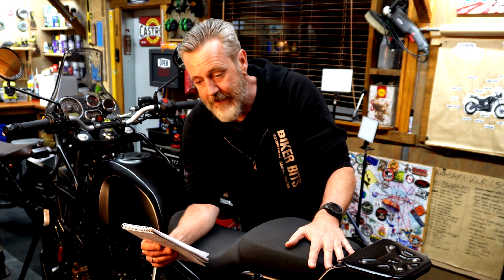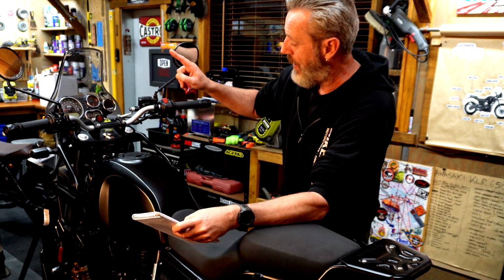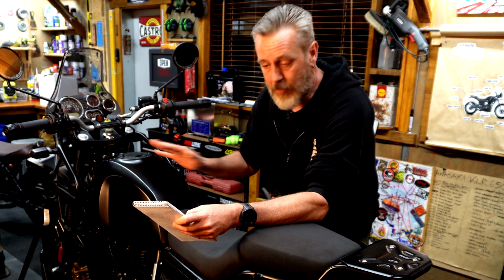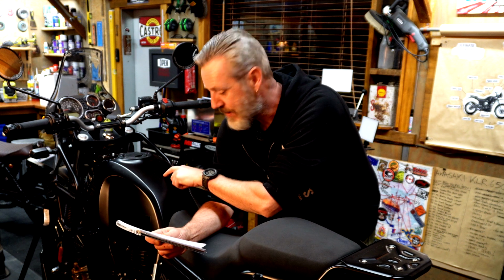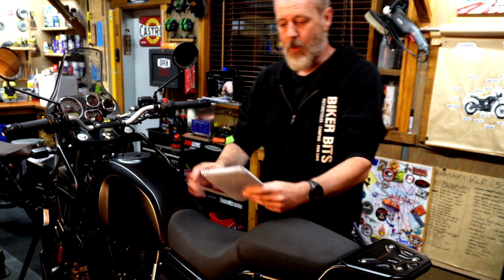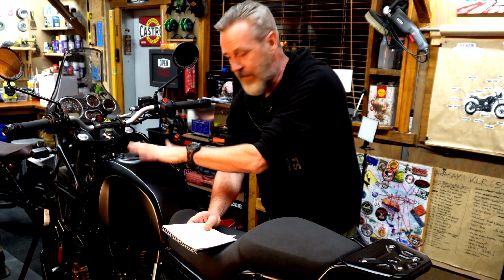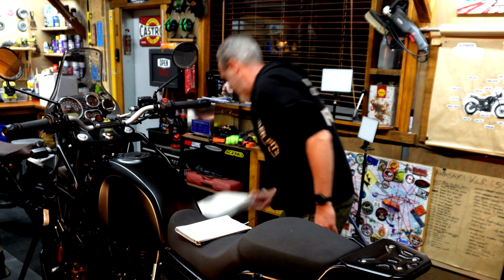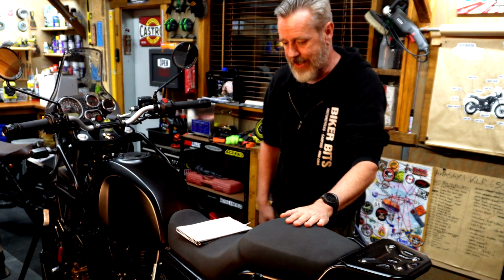The rear is 95 kilograms, the front is 93 kilograms, so that gives us 188 kilograms. Now, they say 191 kilograms curb weight. In Australia, curb weight means a full tank of petrol, all your oil, everything full. So I reckon there's most probably about, I'm guesstimating, 7 litres could go in there. That will bring us up to 195 kilograms. So 195, 191, there's a little bit of give and go, and of course I'm using bathroom scales. So if they're saying 191 kilograms, I'm saying, yeah, I agree. That's what it weighs. Cool.